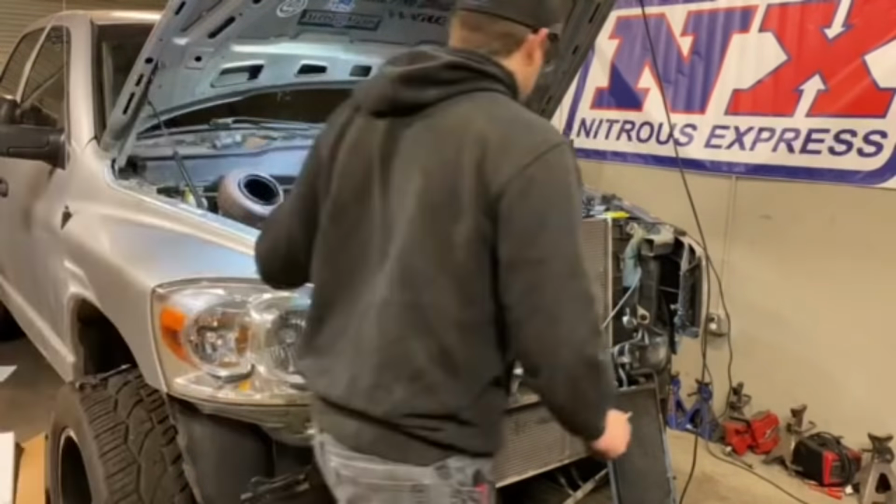Now guys, I say this because we just had such high hopes that this shaft would be like somehow a miracle worker. But as you guys can see here, we did twist it a little bit. Again, PDD does not rate this shaft for what this truck was doing. We thought it would last longer. It got 12,000 miles, about 3 months of use. Just a slight twist. The converter looks just fine. The fluid came out nice and red.